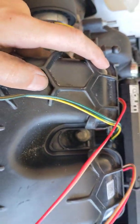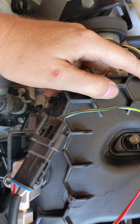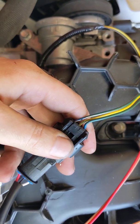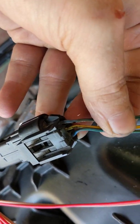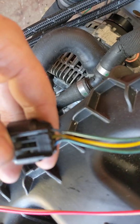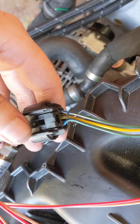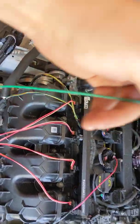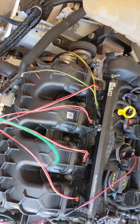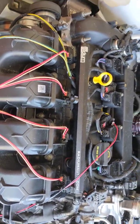All of the instructions I was able to find were for a 2013-2014 Ford Focus ST and they listed a gray wire with a purple stripe. However, if you have a 2015 or newer Focus ST, your wires are not that color. These are a little faded but you can still kind of see the color. Some instructions say to use the leftmost wire, but depending on how you're looking at the connector, you may not know which one you want. This green wire is the signal wire for the split-second controller so it can see the return voltage on the map sensor, and that way it knows when to fire your auxiliary injectors.